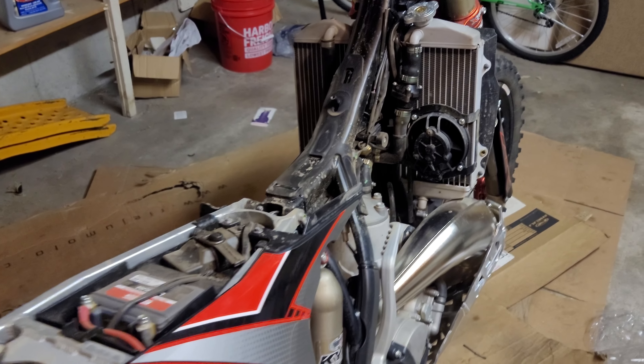There you have it — I have the front plate on. Haven't quite got the plastic cut yet, but it is very sturdy. If you look at how thick that metal is, everything is wrapped around with the rivets I had to shave down. This is very form-fitting — it's very tight to the rad. This front plate is very simple: all it does is bolt on. It's a little bit of a pain with my ratchet to get in there to tighten the bolts down, but I Loctited everything and made sure the grommet bolts were nice and tight because you can't get to them after you put the front plate on.